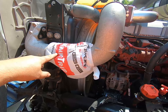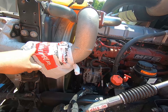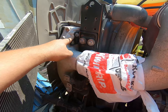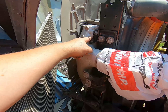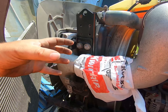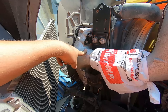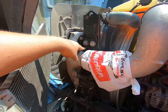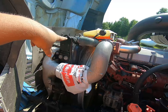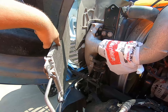A little tip: when you remove these charge air boots, put something over them to cover them — put a plastic bag or something. You don't want a bunch of dirt getting in there; that's gonna go right into your intake. I've got her loosened up down there and took one bolt out on each side. Next step is I'm going to have my partner help me — we're gonna take these last two bolts out and lift this thing. It's gonna have to go forward and then up. It can kind of be a pain because you're working in a tight spot, but this truck actually doesn't look too bad compared to some of the Freightliners I've done. Just pull her up and out of here — be careful not to drop it on any of your components, and especially watch your condenser so you don't damage that.